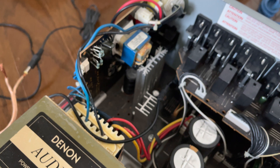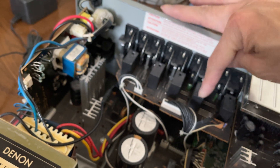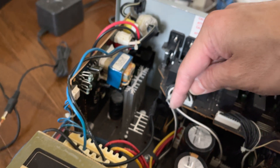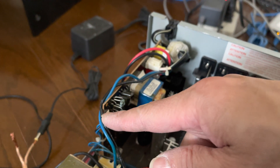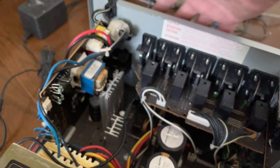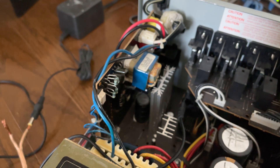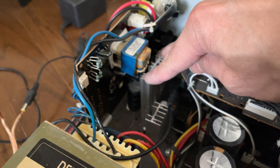To resolve the problem, you have to remove this board from the amplifier. Remove the speaker output board, disconnect the brown cable, cut and loosen any wire cable ties so you can remove the board. There are a couple of screws towards the back — one silver holding this board, three holding the power output panel — then you should be able to remove the entire board. The problem power area involves the plus and minus 15 volt regulators.